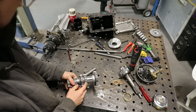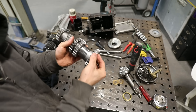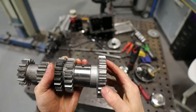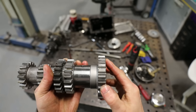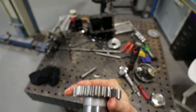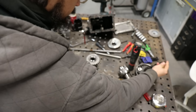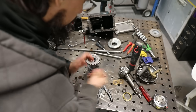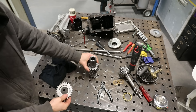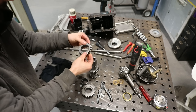The one we need to replace is third gear. The only markings on the teeth are some slight scoring going sideways — you can kind of feel it a little bit with your nail. This has oval circuit hot rod racing ratios in it where second and third gear are almost identical, basically for running on long and short tracks so they don't have to change their diff ratio — they just either run in second gear or third gear. But it's only the third gear that's different to the rally ratios, so that's the one I need to replace.